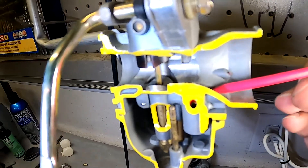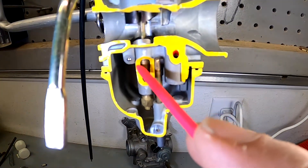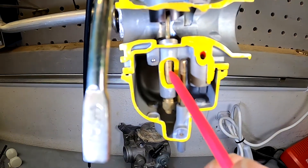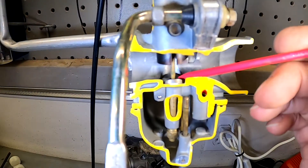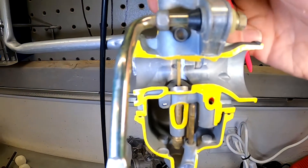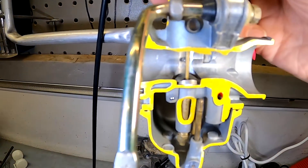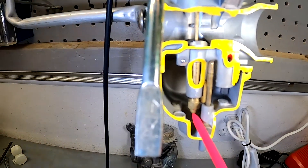Air is also going through this orifice here, right around this main jet nozzle. The main jet is sitting here on the bottom, starting to pull fuel. Air goes around here and in through these holes, helping atomize and pull fuel up through there via the vacuum created here. As you go to more full throttle, the needle right here tapers down and creates a larger hole to add more and more fuel. Once you get to full throttle, the needle is no longer effective and the size of your main jet is what's controlling fuel delivery.